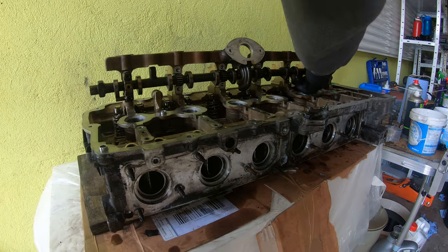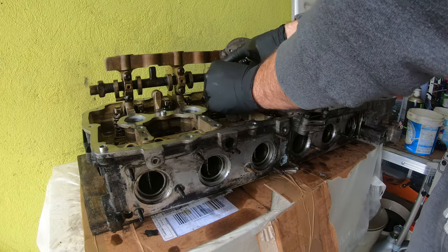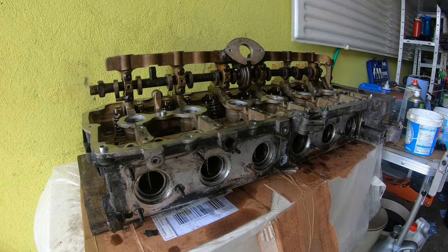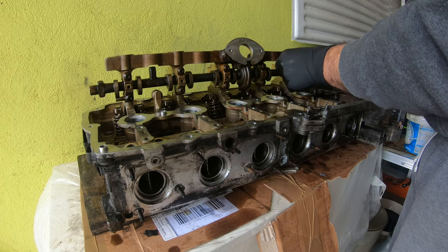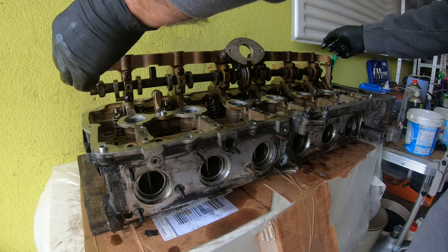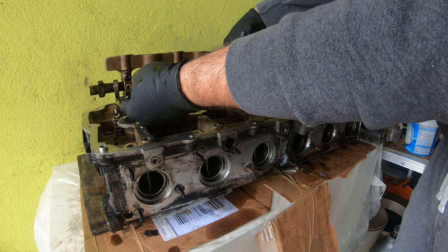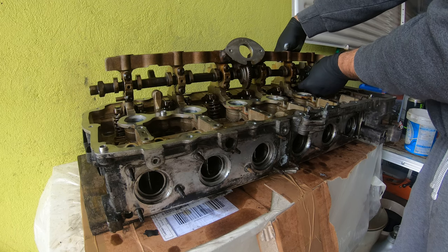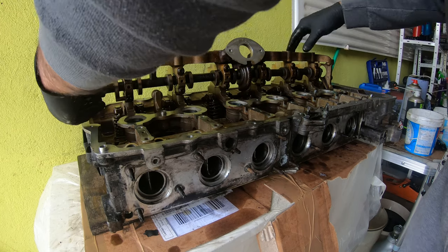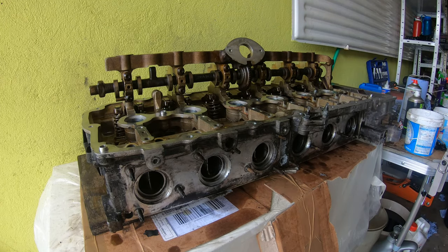There's a little stopper here and a little stopper right here that you have to screw in. So I'm assuming that's right. Caps are back on, put a little bit of oil on each of them. It does center on this shaft gear here. And there is a stopper here, and there's a stopper that you have to screw in over here between cylinder one and two later. So it rolls nicely. I'm gonna go get the torque specs and torque this down.